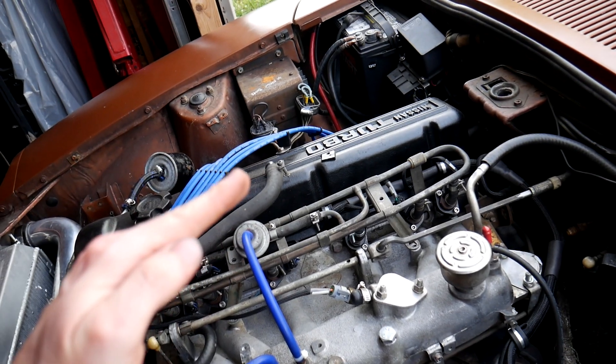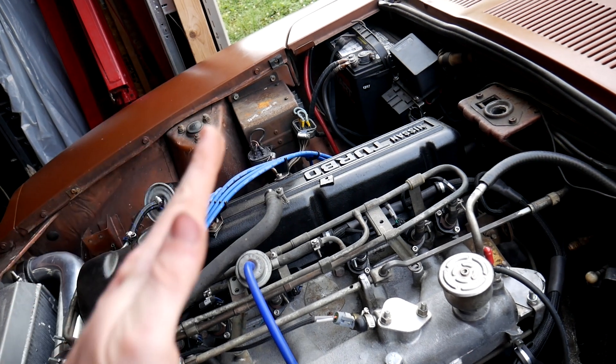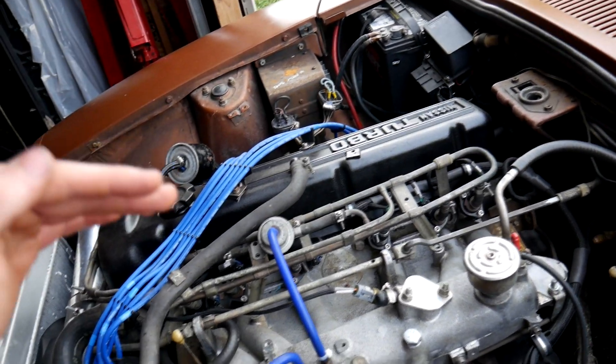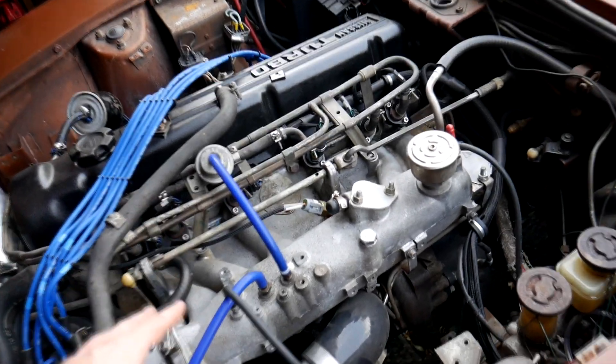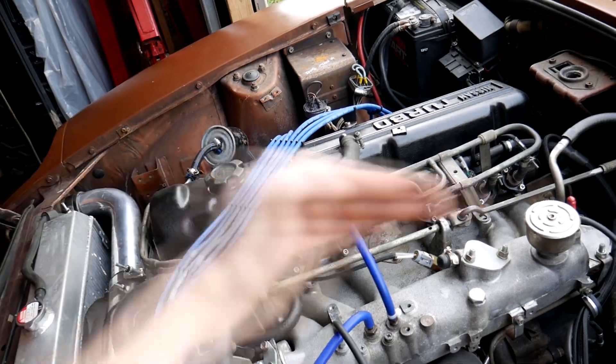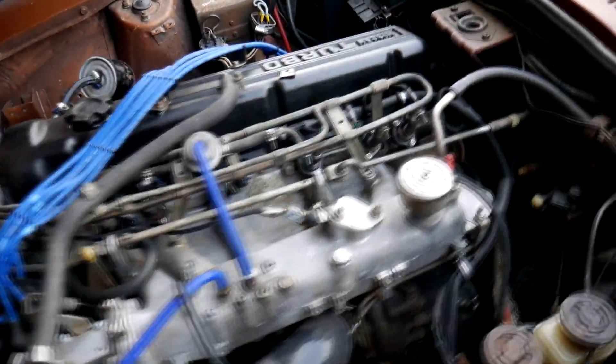Basically, let's say you're looking at your AFR map — your air-to-fuel ratio map. You'll notice when you give it gas, you should get a different type of curve. If you don't have your vacuum gauge hooked up to the ECU, you're basically just going to get a flat line the whole time and wonder what the heck's happening. That actually happened to me and it took me a while to figure out. So hopefully that helps some people in case that happens to you.